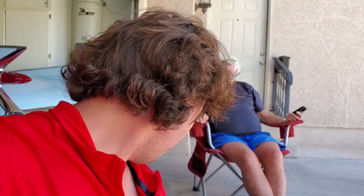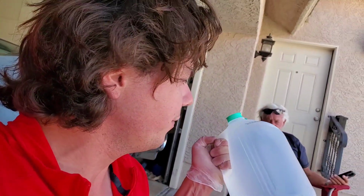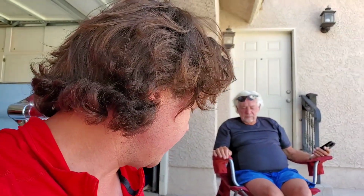Yikes. All right, so after seeing how clear this was, Dan and I said, you know what? It's going to be fine, so we're just going to fill it. Now, if you're into racing and stuff, I definitely recommend you go ahead and do the second drain and fill. So we didn't go drive around the block with distilled water only and then drain it, come back and do it again and turn the heater on. That's what you want to do if you really want to get it all out of there. But Dan's happy with that.